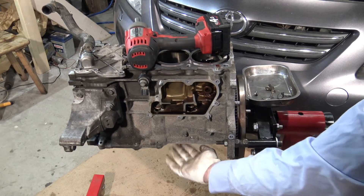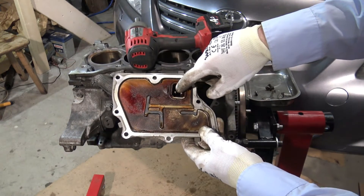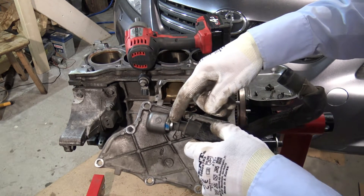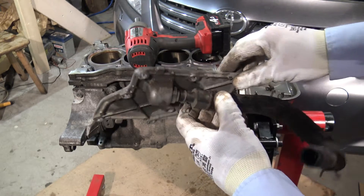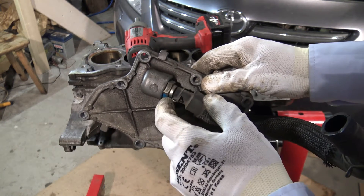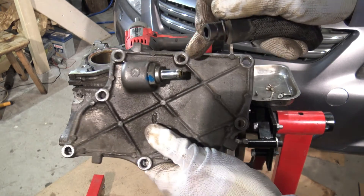The air goes indirectly into this intake manifold, and on our cover there is a part where this air goes directly into the hose to the intake manifold and then to the engine. There is also this valve that keeps the engine's inside pressure at the right amount. If we have issues with this ventilation valve, we need to replace that valve in here.